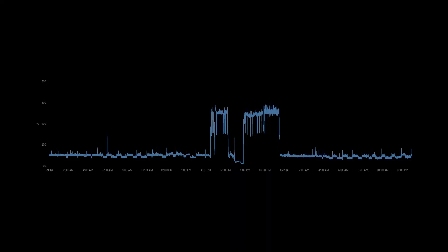Here's another example — my gaming PC. It idles around 150 watts and goes out to about 400 while playing first-person shooters. It's an i7 with a 2070 GPU, two monitors, a router, an access point, and other gaming devices all plugged into the same power bar. I'm monitoring this with smart plugs using Home Assistant, which is pretty cool for measuring your power draw.